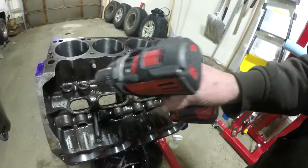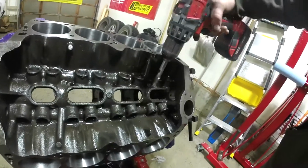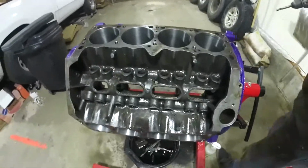All the oil runs through the journal, goes down to the main and up to the camshaft. Unfortunately, after about 5,000 RPM of sustained high RPM, it will starve number 4 and 3. You'll almost never see any damage on 2 or 1, but these are 90-degree passages, so oil doesn't flow at a 90 degree very well under high pressure, high stress.